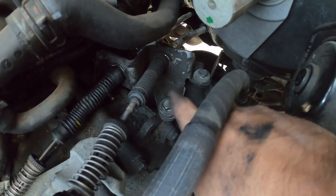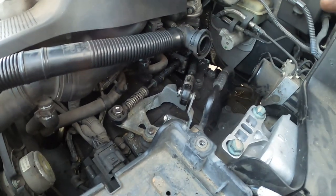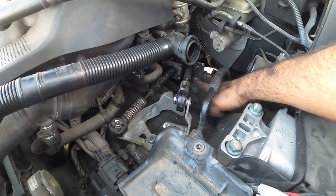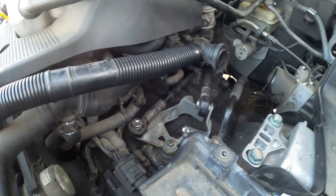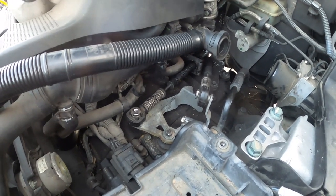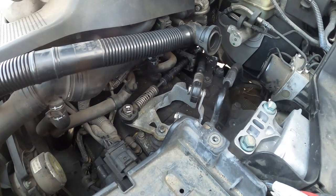That also helps drastically on the feel of your shifter. You get more of a clunk, so it has a nice, easier and smoother shift. Again, it all depends on your setup and how you want to enjoy your drive. Personally, I have the metal bushings down here. I'm getting ready to upgrade to the metal ends on these as well, because I want the harder, clunkier shift, especially when I'm doing some hard runs. It's not grinding, it just clicks in better. It also has a better feel for shifting, like you know where to find the gears.